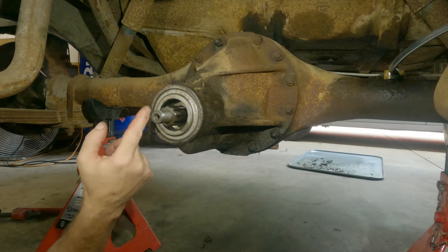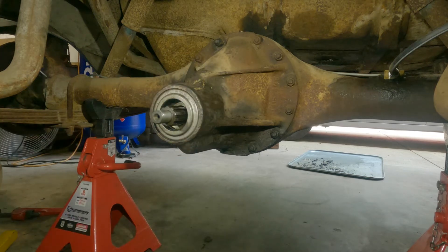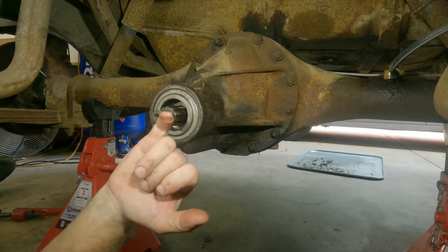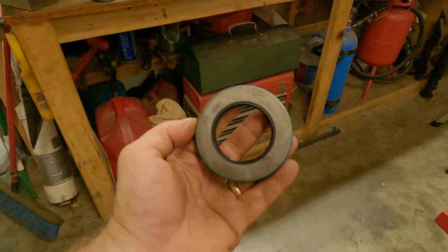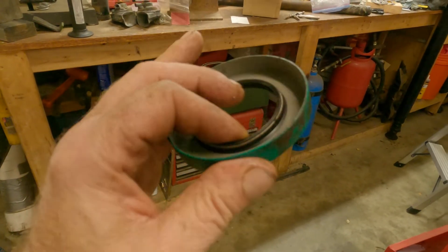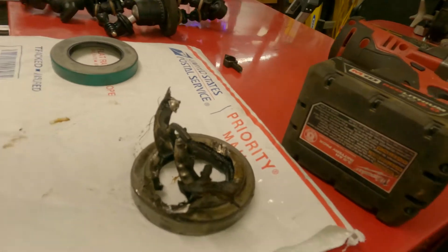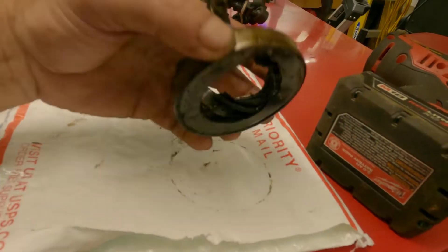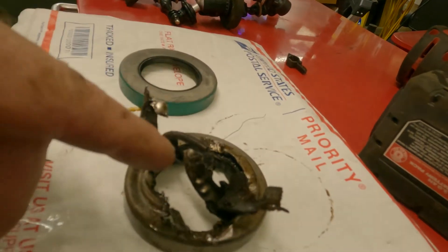It's got to go coast to coast. Let me see what it looks like, see what I can find. This is leather in here - it's wet. That's good. There was damn little fluid in this thing - it all went out the back. Several days later - here's the pinion seal, the new one. SKF 18880. Here's the old one. That didn't cooperate. That's a big seal. This one's got the rubber lip - the old one had a fiber deal in there.